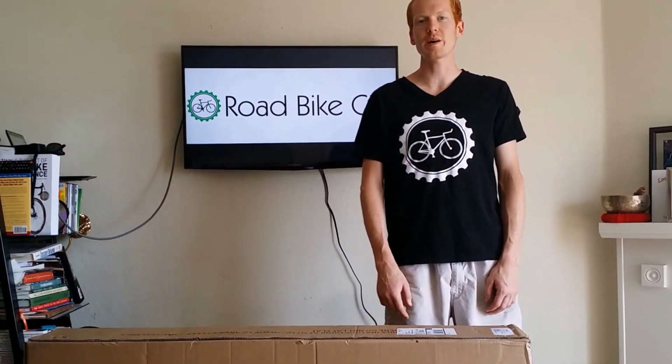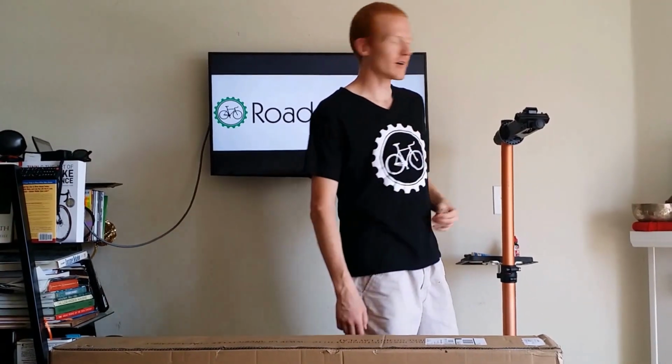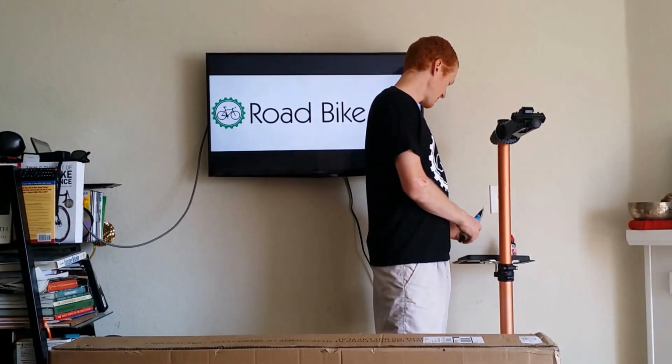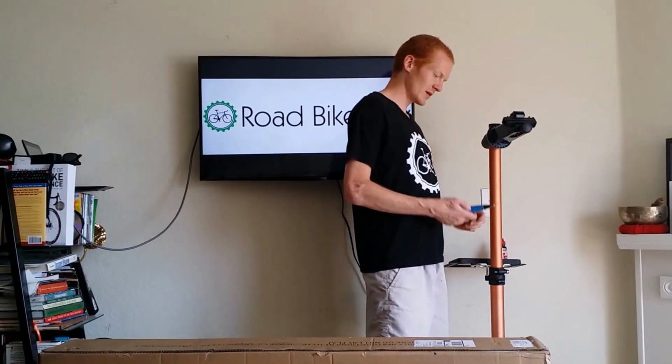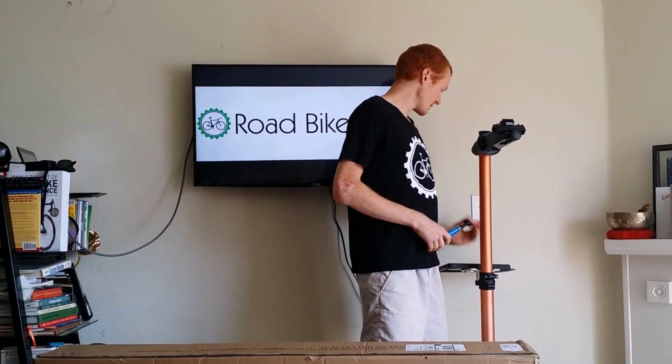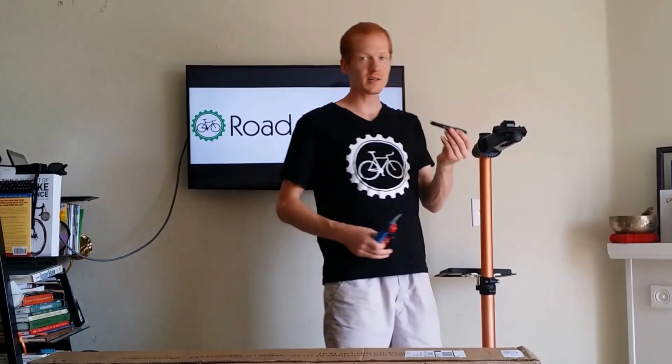I want to show you guys today how to assemble the Vilano Forza 4.0 road bike. Some tools you'll need for today are a set of Allen keys. Most commonly used are the 6, 5, and 4mm Allen keys. A wrench set. You'll need a 15mm wrench as well as a 10 and an 8 possibly, but an adjustable wrench will also do. A tube of bike grease, some lube for the chain, and a box cutter knife.